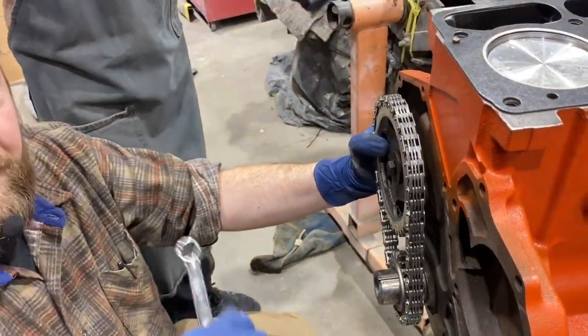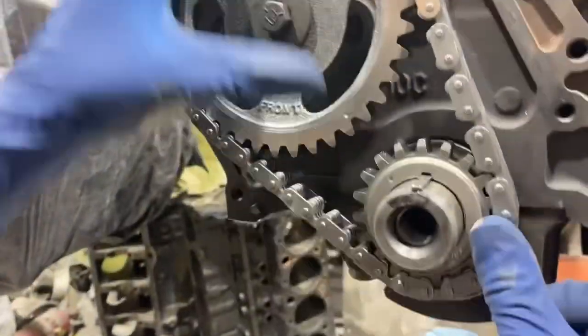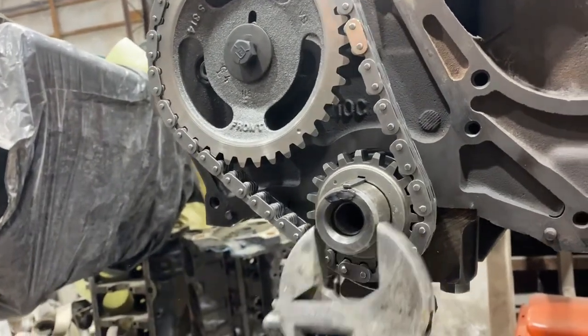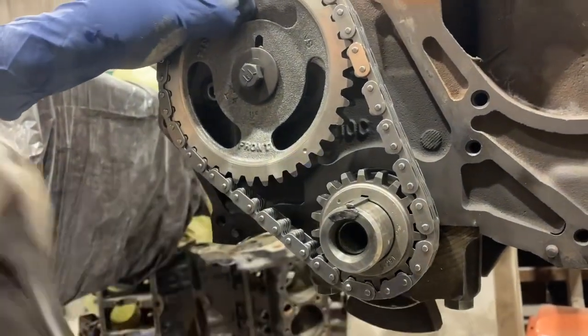So if you come down here and get a close-up look at our dots — putting the camshaft in this thing. I'm just going to set that right there, and smack that back right there a little bit. So the dot right here and the dot right here.